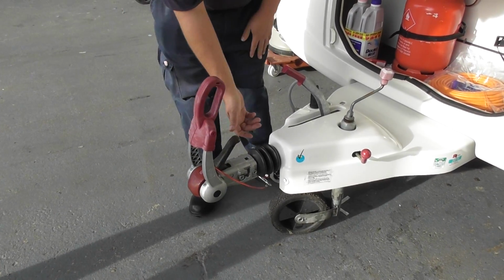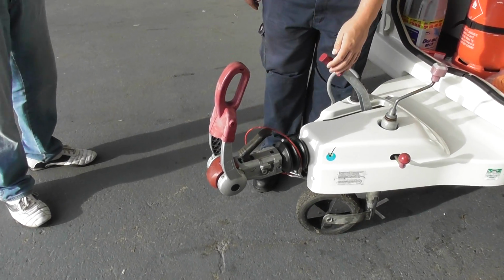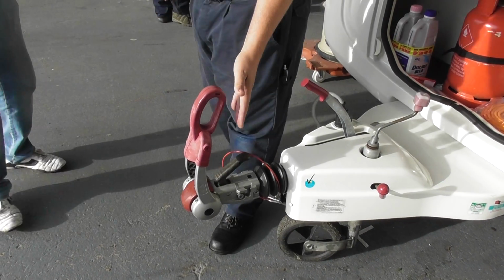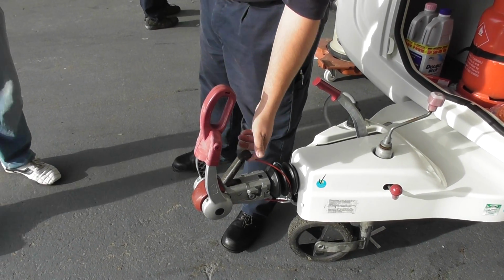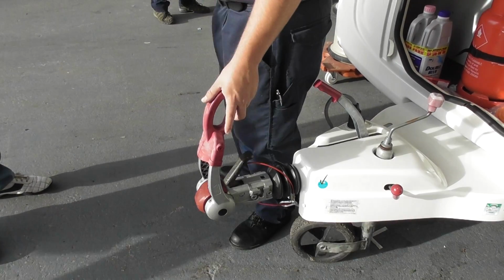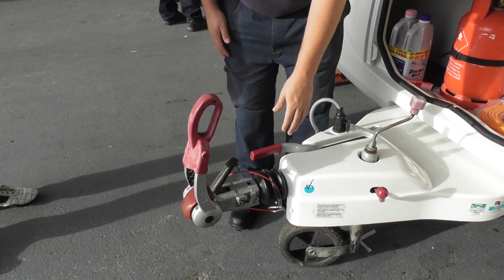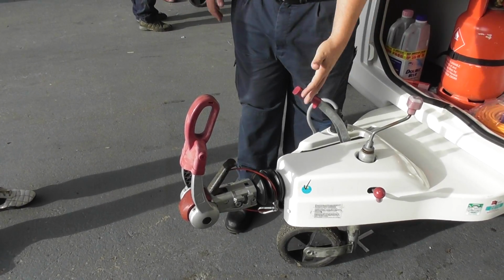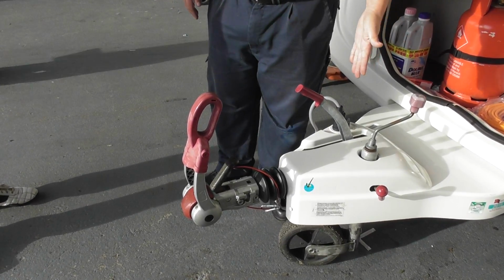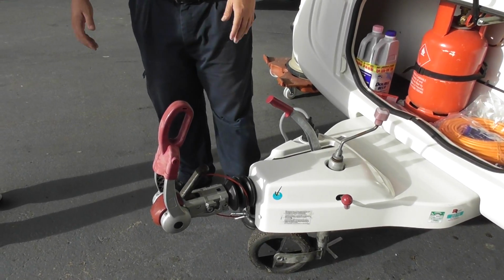So, stabiliser, main hitch underneath, then we've got your breakaway cable, handbrake on this one. Sorry to interrupt, that's your main hitch, not this? No, this is just your stabiliser, and this is your main hitch underneath. So this is what actually clips it onto the ball. It just grips onto the ball as such. So the handbrake is as easy as handbrake off, handbrake on. Simple as that. No buttons, no ratchet, nothing. If you're on a slight slope, it may pull itself on all the way back. Don't be alarmed by that, it's just the more pressure that the brake pads need to stop the wheels from turning.